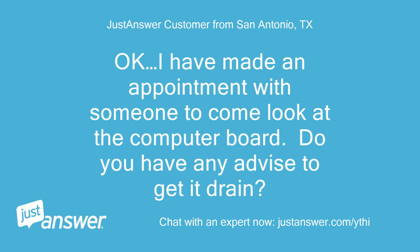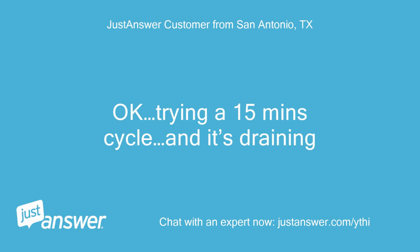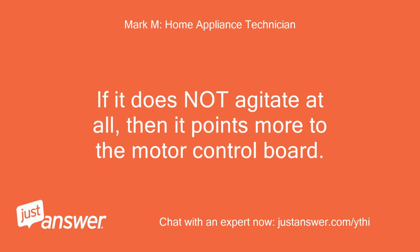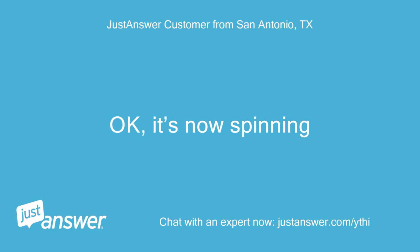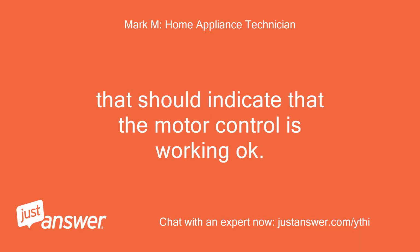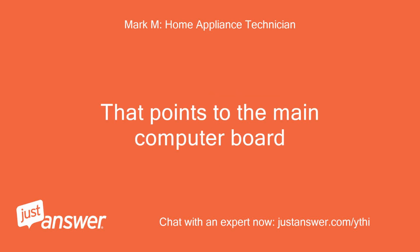Okay, I have made an appointment with someone to come look at the computer board. Do you have any advice to get it to drain? Okay, trying a 15-minute cycle, and it's draining. Yes, there is an issue with either the motor control board or the main computer board. If it does not agitate at all, then it points more to the motor control board. Okay, it's now spinning. Okay. That should indicate that the motor control is working okay. That points to the main computer board.